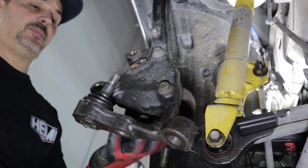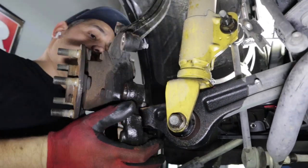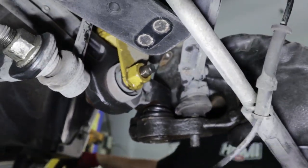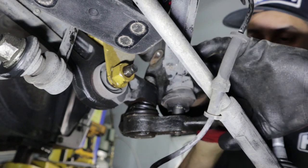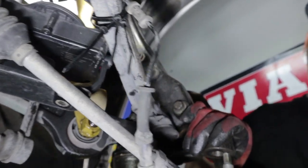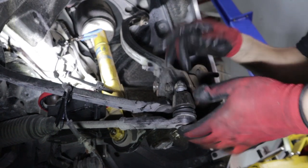We're halfway there — I think that was pretty quick. When I was doing this live before, it was taking a lot longer because I didn't have everything ready. I put the first one, lower control arm rear, then lower control arm forward is right in front of it. Put those together and you can put the bolts back on and tighten them. And then we have the tie rod end, with a 21mm to go with it.